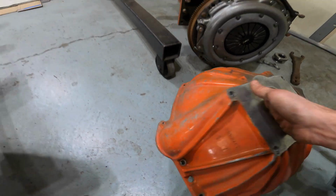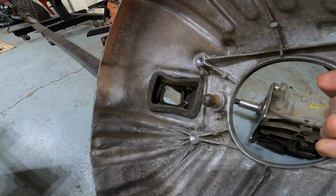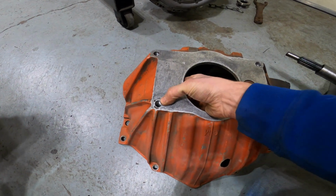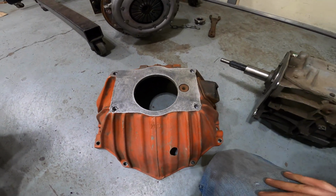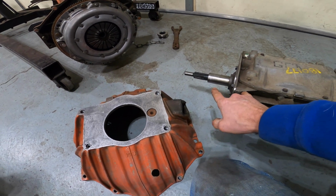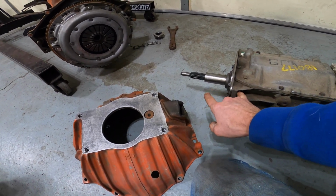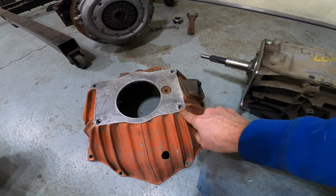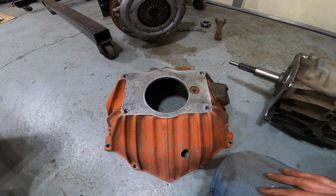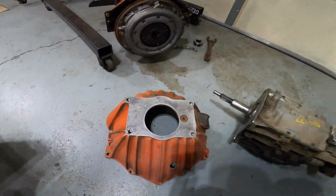And this is pretty thick, the threads are. I mean, they're probably an inch and a quarter worth of threads there. So I could just leave it and get the proper length bolts here, which I'm going to do anyways, and just live with it having some garbage at the beginning of it. But what we're going to do instead is fix it the right way, and that involves helicoiling it.